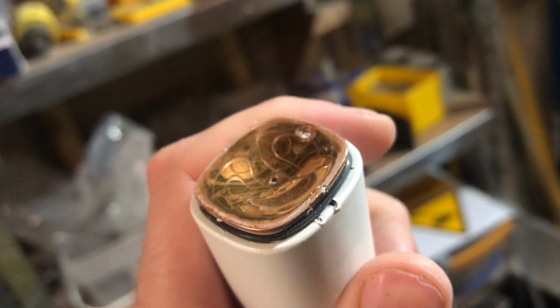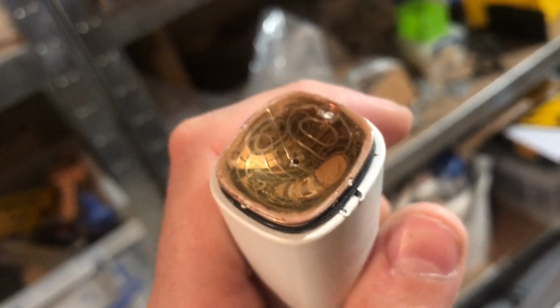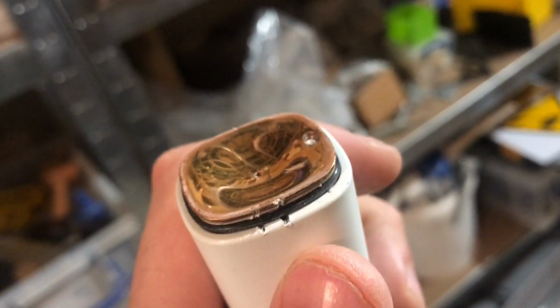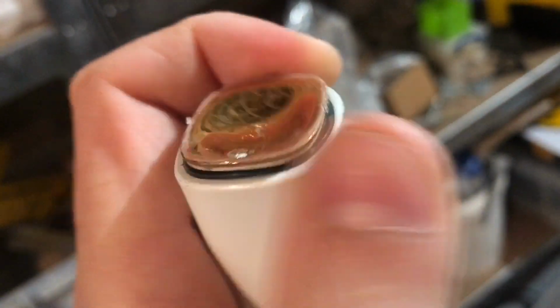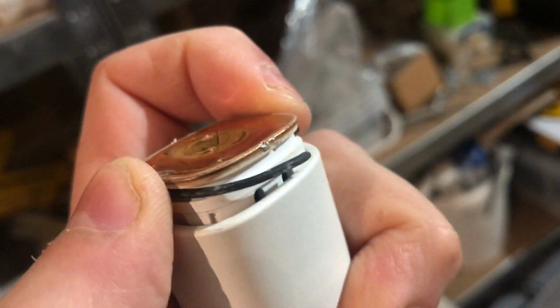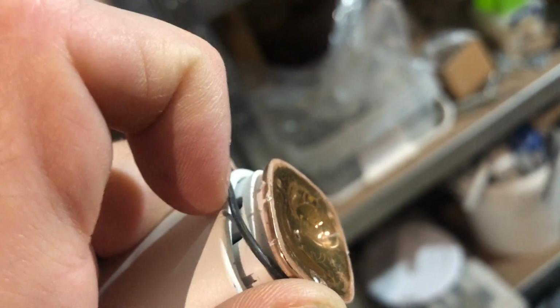Anyway, we don't care about wrecking it because we think, well, I've paid 150 quid for a toothbrush, or 70 or however much he paid, and frankly I just want the damn thing working without having to shell out more. So we go ahead and we shove a screwdriver in. Now when you shove the screwdriver in, this is obviously flush, I haven't put it back. The thing you have to know is that you have a seal, and this seal will break when you shove the screwdriver in. At least it will if you don't know that it's there.